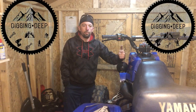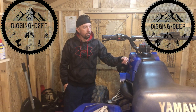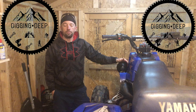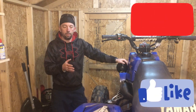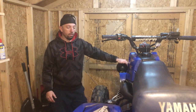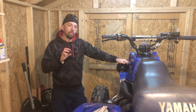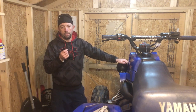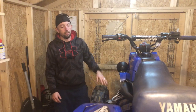Today, guys, we're back on the Banshee project again. We got a few more things coming down the pipe with this. Number one thing is trying to diagnose an engine noise on my clutch side. We think we got that figured out. I think it was the idle gear bushing. There's about a half inch of play there. So yeah, we're going to get that. We got that bushing coming in today.